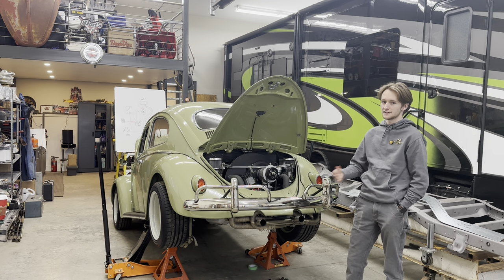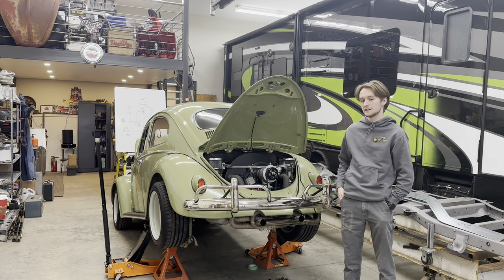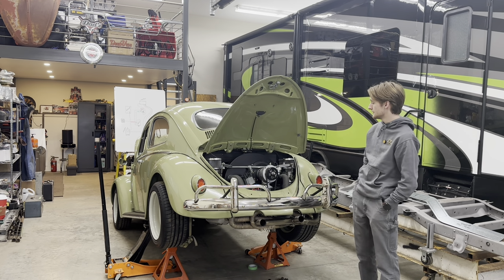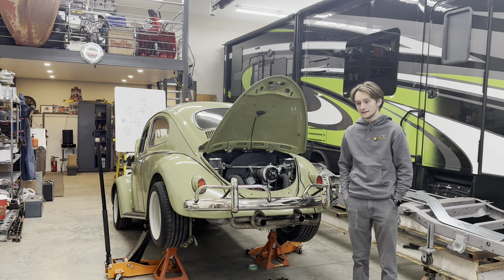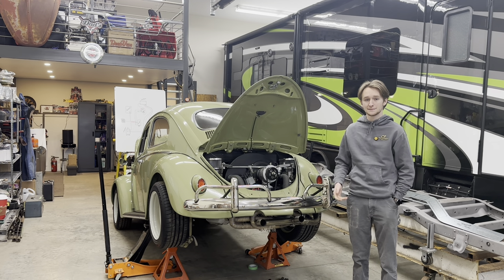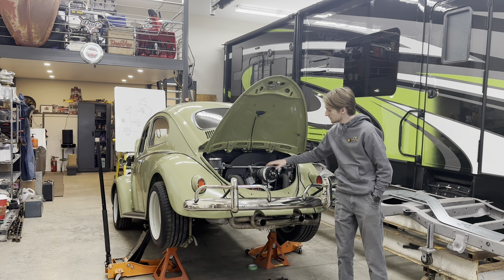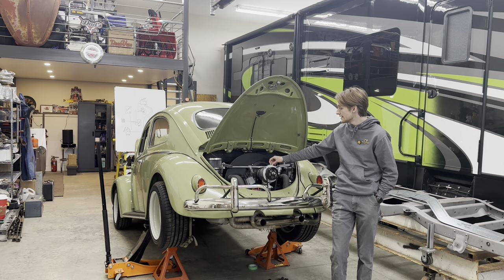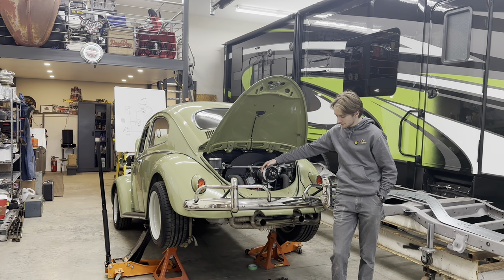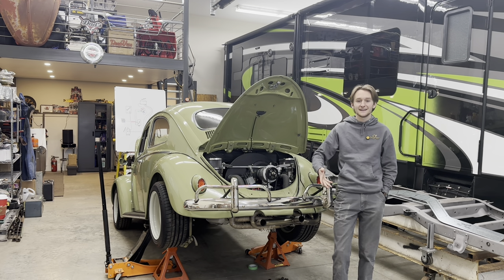So the biggest issue — you might want to check out my last video where I did part some things, but this video is just a continuation of that. I'm still having a charging issue, well not just a charging issue anymore because I actually fixed my charging issue. But when I fixed it, I somehow made it so that when I turn my key off, yes it disconnects my battery, but the power coming off my alternator is still staying in circuit with my coil, so it just stays running even though my key is off. The only way to stop that is by manually disconnecting my alternator, which isn't very good. I've been avoiding explaining the exact problem because I didn't feel like having people tell me I'm a dumbass for not figuring it out. But this time I'm going to lay it all out and explain exactly what happened.